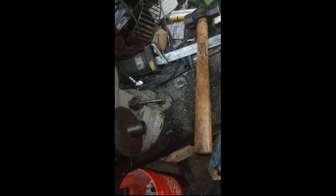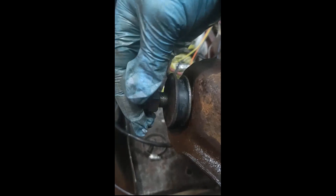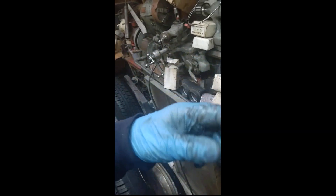I'm going to hit it a couple more times to make sure it's correct, putting it in the vise by the mounting point. I also use a thread chaser since sometimes when you try to hit it out you catch threads - not a good thing. It's been about a year since I did this on my Cutlass. When you install the control arm in the car, you don't want these bolts all the way tight right away. You really want to get the car down on its four wheels first.